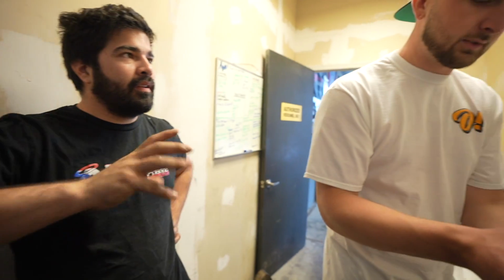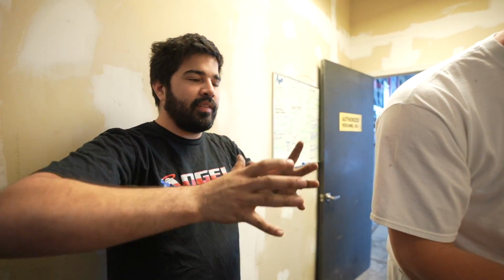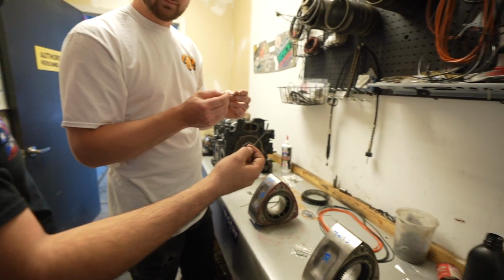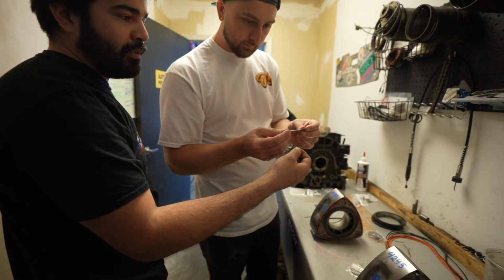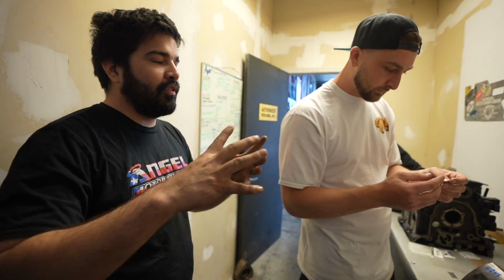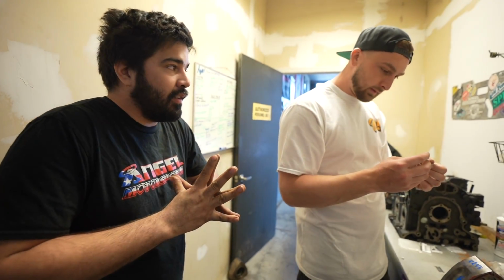These springs for the apex seals, they're only to have compression at crank. Okay. Once the engine's running, inertia takes over. Oh, that's cool. Yeah, it'll push the seal. So if you think about it, you're like, how is this spring holding all that compression, all that power, you know, when the car's running? And it's not, it's just the force of them being sprung out is what seals the housing and the rotors.